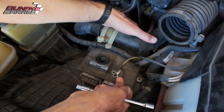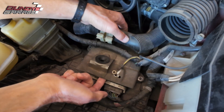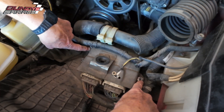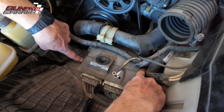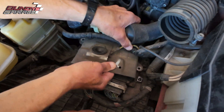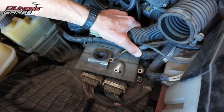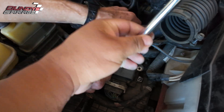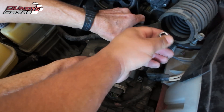Oh wait — they're not even using that. Interesting. The cover plate is only held down here and here. So we already took one off of the actual computer, and the second one for the computer is back there, but we can lift the cover plate and that'll help us get to this one down in the corner — which would otherwise be very difficult to get to. Moving the cover plate allowed me to get this out of the way, then you can break it free.